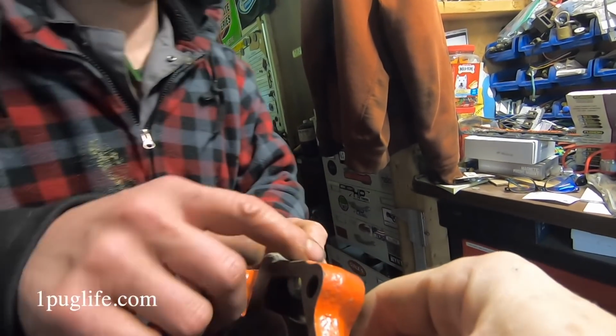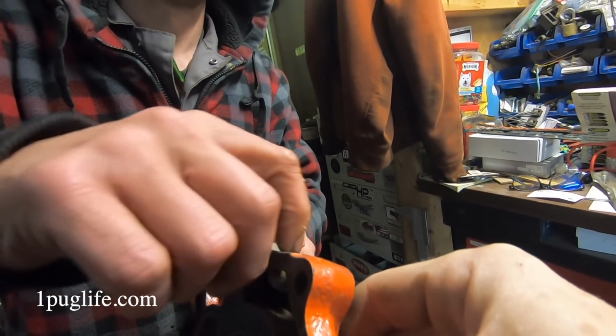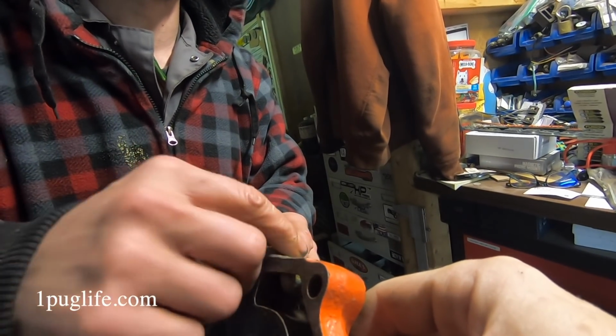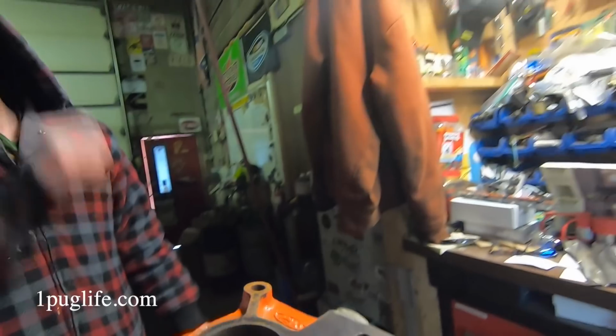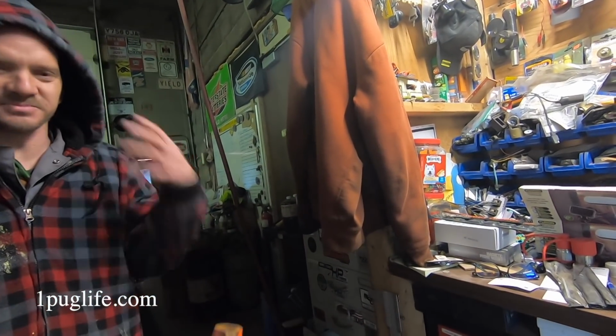I'm thinking this stuff here, if it'll hold, you can see I used a carriage bolt here, right? And I cut the sides. It shouldn't go past here because I got the block, but if it does, I'm thinking I should just get rid of this stuff and fill weld it. You could probably just cut a little plate that fits in there and then weld it all the way around. You know what I mean? Just because it won't get past here, I know that, but just to make it...